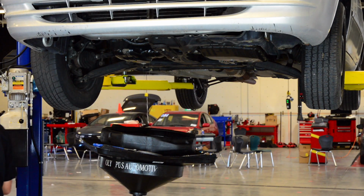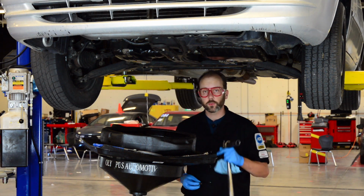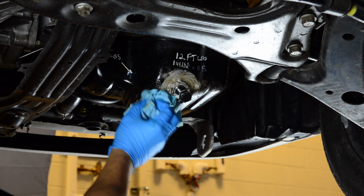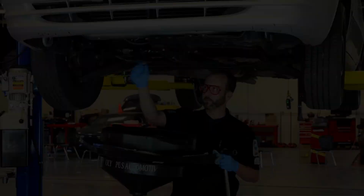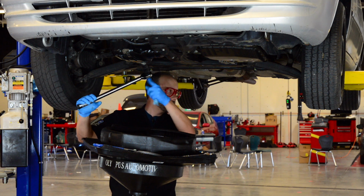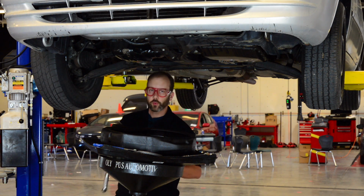We grab our drain plug, and this time we have to torque it. So we're going to grab a socket and a torque wrench. Remember to set your torque wrench to the specified torque, and when you're finished with it, always put that torque wrench back to 0. We're going to put this in. We're going to wipe up any oil residue that we have and finish installing the plug. Take our torque wrench. Be careful and try to pay attention to that click. You guys can hear that. That can be pretty hard to hear in a loud and noisy shop, so watch for it and feel it. Okay, make sure we put this back to 0 and put the tools away.